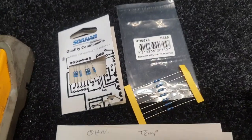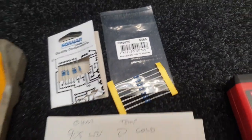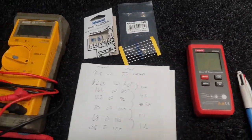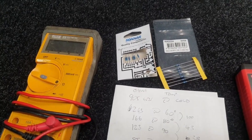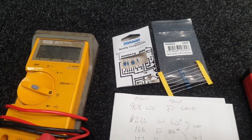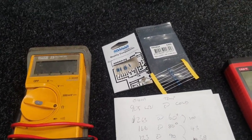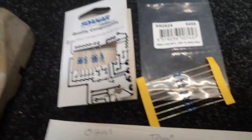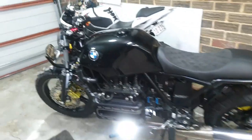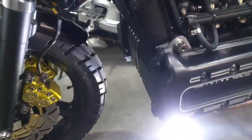I headed down to my electronics store and got some 30 ohm 0.5 watt resistors and some 10 ohm ones as well, just in case I had to bank some up. I fired her up with the temperature gauge on it. I put the 30 ohm in series between the OEM sensor and the cable going up to the Moto Scope Pro — it wasn't quite there, still about 7 degrees out. So I ended up putting a 30 ohm and a 10 ohm in series, making 40 ohms of resistance, fired her up and it is working perfect.